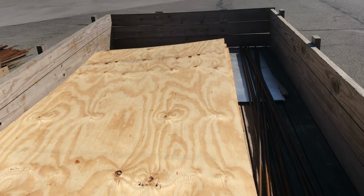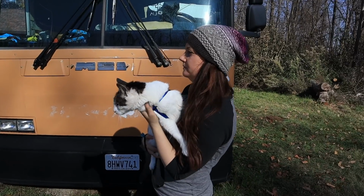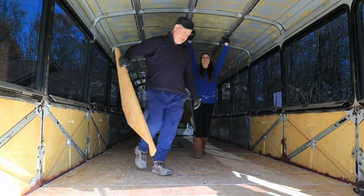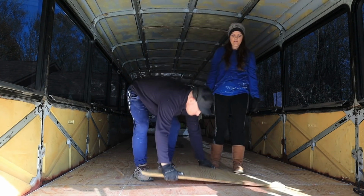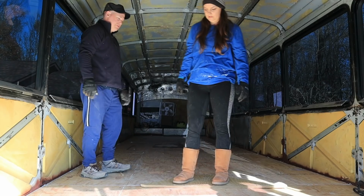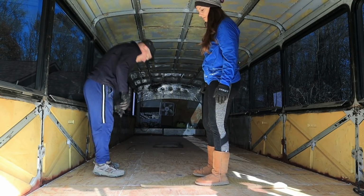However, now that they're down, we're not happy with the results. It has a little give, you still feel it kind of sink. If we could go back in time and do it again, we'd use 3/4 inch plywood on everything except for where the back hatch is. But at this point, we felt that it was the best solution for us to keep moving forward with the build.